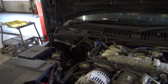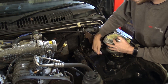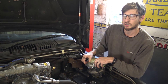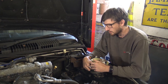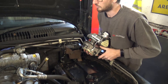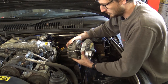However, it doesn't help that on your car someone put an LPG vaporizer there too. That can always move. There is lots of space this side. Now granted we've removed the air suspension valve block and box. It's not really an issue — my car's on coil springs, not everybody's are. However, the valve block is just very small pipework and a few wires that could be relocated in many other places. The pump doesn't necessarily need to be next to the valve block or anything like that, so that can be moved quite easily. Obviously the air box is going because I'm not going to run a conventional air box — we're going to run twin filters on this. So the idea is run a link pipe from the right bank to the left bank, which has its own issues but they can be overcome, and then mount turbo A somewhere in this area and turbo B somewhere in this area.